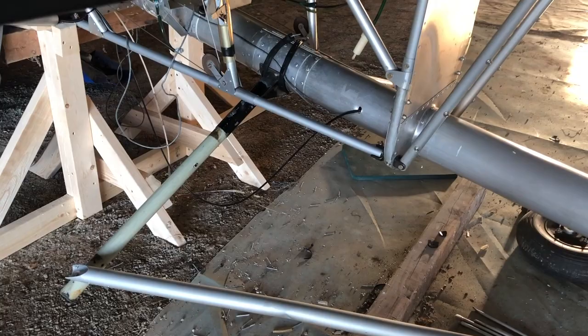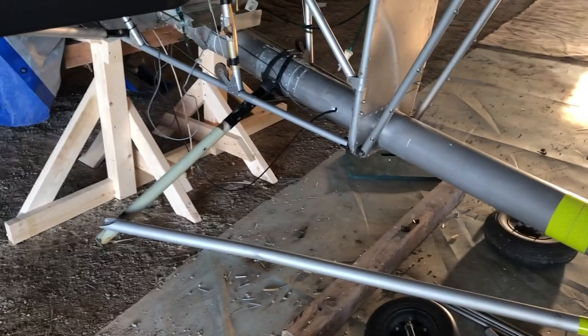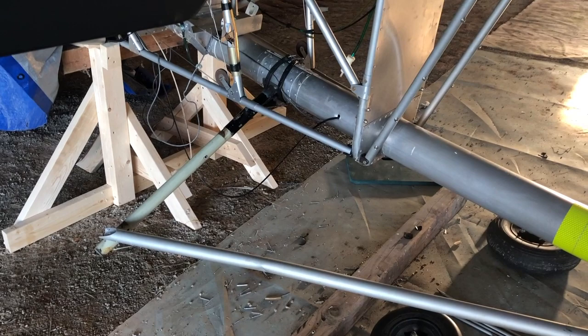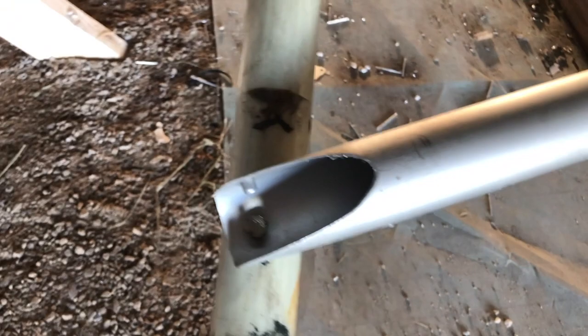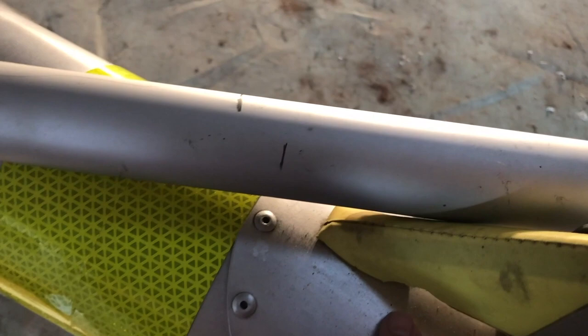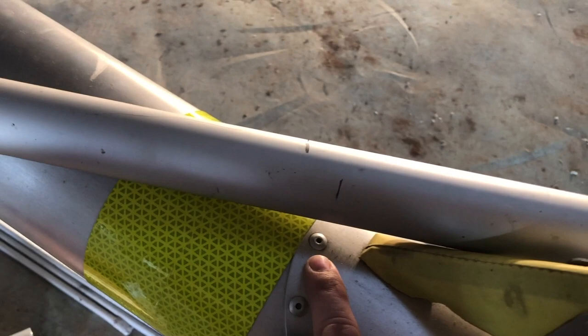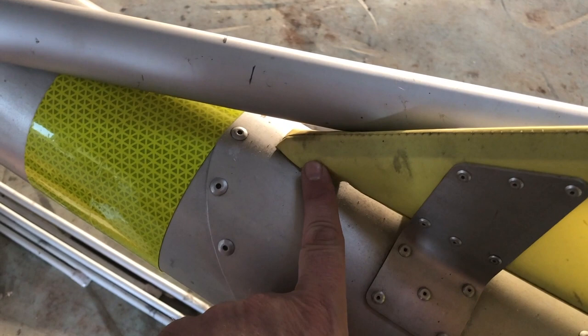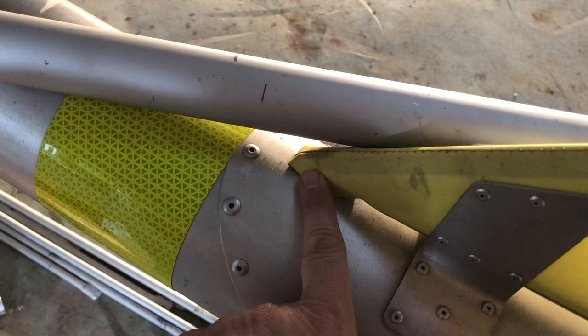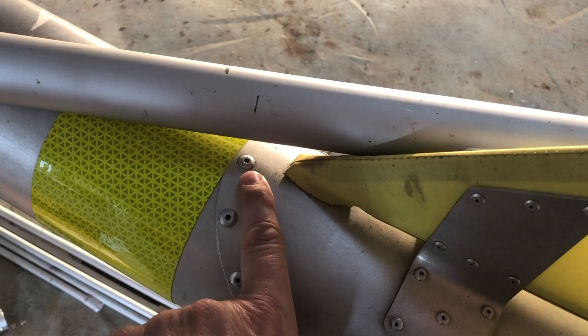I struggled a little bit — I didn't have a rope and I'm out here in the pole barn hangar with limited tools. So I used my old rear strut tube, actually drilled a quarter-inch hole in one end, dropped the bolt through the hole and the gear where the axle would attach. I'm measuring back to a fixed point — in this case, the center rivet on the boom tube for the tail. It doesn't look like it's in the center because the vertical tail is adjusted to the right, the starboard side, for the slipstream effect of the prop. This is a good centerline reference — probably not perfectly on the centerline of the boom tube, but close enough for what I'm looking for.